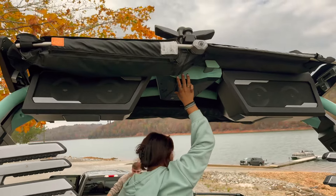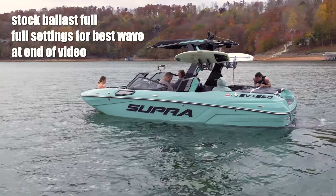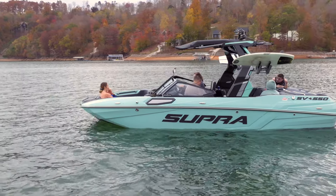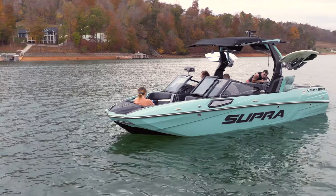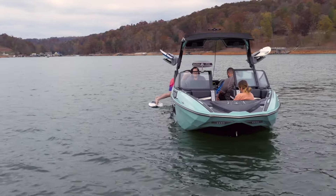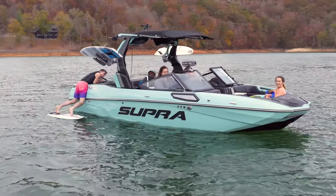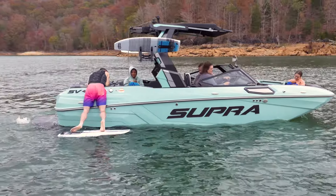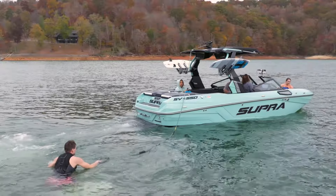I love reviewing these boats, but I have to be honest — I don't get too excited when I'm going to review anything under 23 feet. Shorter boats just have to be handicapped. They can't displace as much. The shorter hull usually doesn't make as good of a surf wave as a longer hull, and the shorter length usually makes the boat have a more difficult weight setup front to back to achieve the best pitch for the best wave. That also means the stock wave will not be so hot.